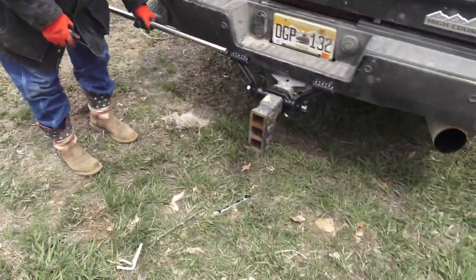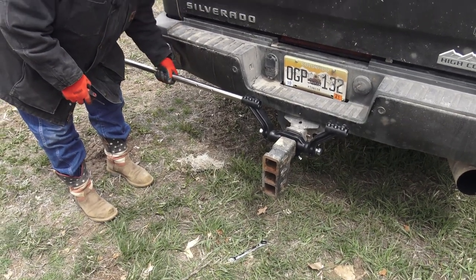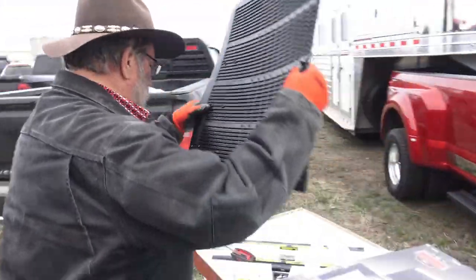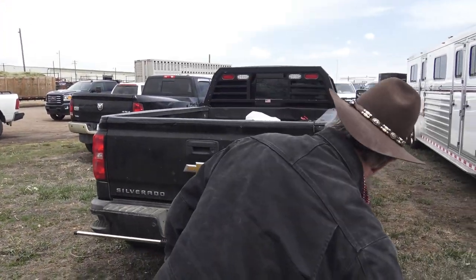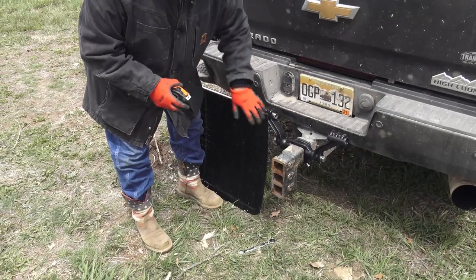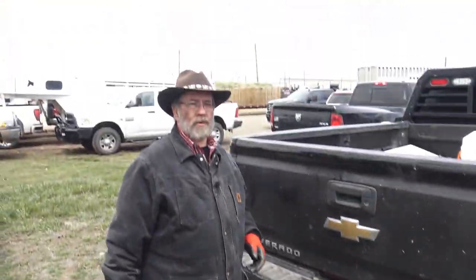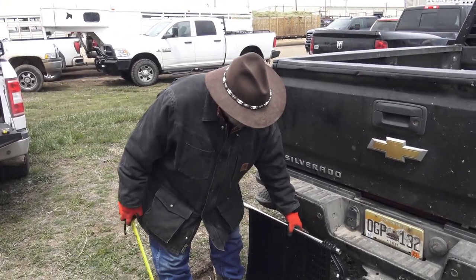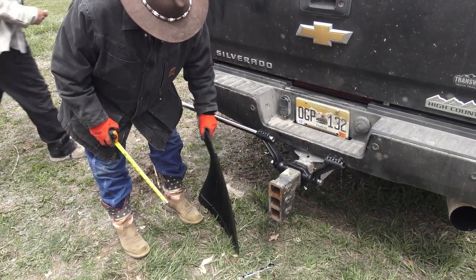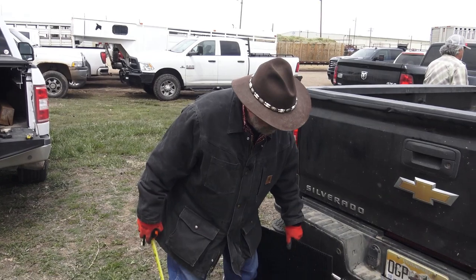In the top of the yoke are the arms that hold on to the mud flap. I'm going to stick this one in here because I want to do some really accurate measurements before I cut the mud flaps. These mud flaps are made to fit all different heights of trucks, so you've got to cut them to fit yours. Now I put that in there — that's your main arm. I'll take the mud flap. When I measured this truck empty, it was 19 inches to the top of the receiver, and then you've got another 5 inches in the arm. So I'm actually going to put them on there and see where that would be. I don't really want these dragging, but I don't want them dragging when the trailer's loaded because you'd be knocking more dust on it.